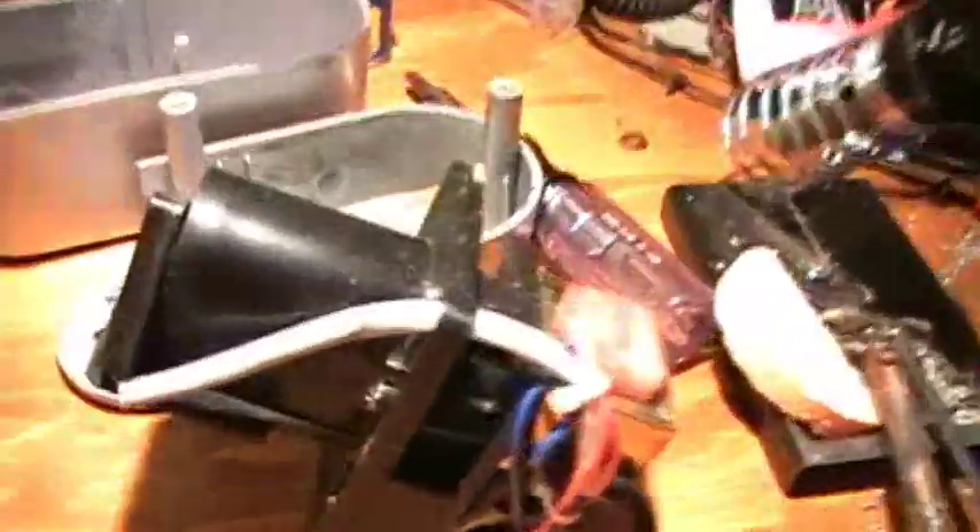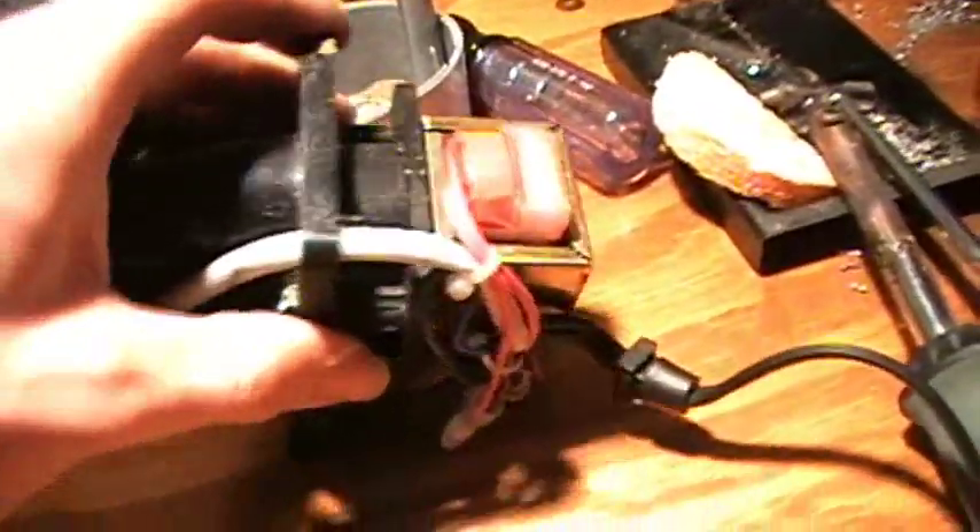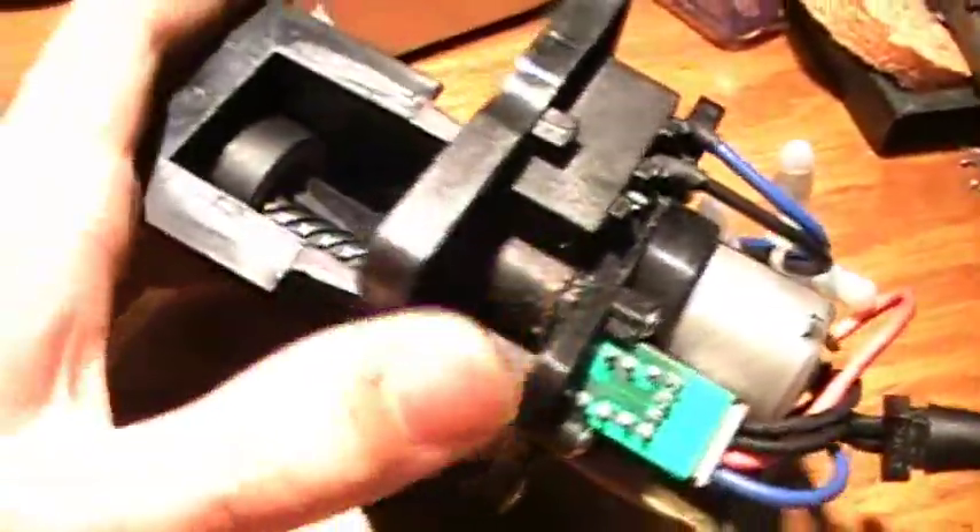So you have to empty it out a lot more often than on the old one, which is nice and big. Now over here is the modern sharpener. Instead of using an AC motor — I fully expected to see an AC motor when I had this thing apart — but lo and behold, there was a circuit board, and I noticed there was a transformer. It's got a full wave rectifier because it's using a DC motor, and note the much more plastic used on this one.